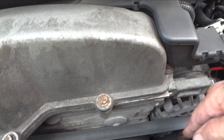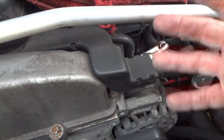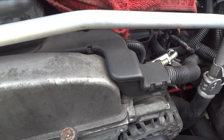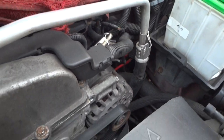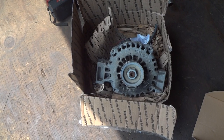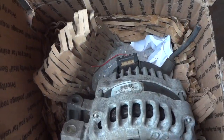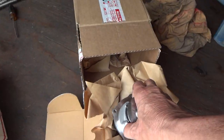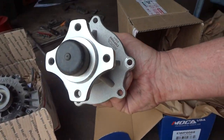I've got a brand new water pump for this, and I've got another alternator. This one works, but at night you can see spikes in the lights — the voltage is jumping around — and it's making a little noise too. It's probably got a couple hundred thousand miles on it. I bought this alternator for about $45 with free shipping on eBay, and here is the brand new water pump — for a 4.2 it's a small pump, I think I paid about $25 for this aftermarket one.